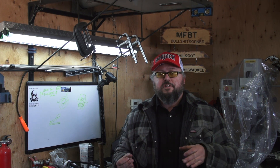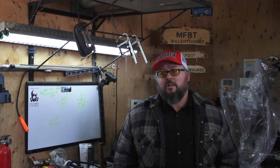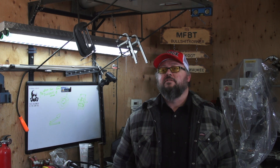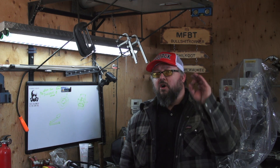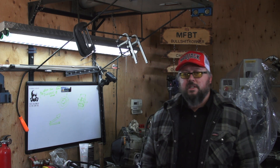That was pretty quick and dirty. This engine has a habit during a cylinder leak-down test of the piston creeping down — that's why I locked it out. It's probably a good idea to lock it out if you're doing this, because if you're doing it on a motor you're leaning over, the fan and everything turns and you can injure yourself. Always stay out of the line of fire. You guys have a great day.